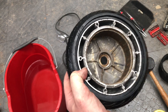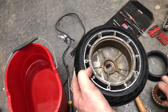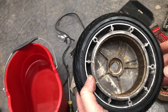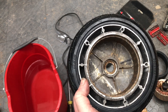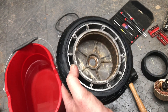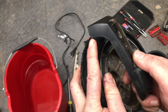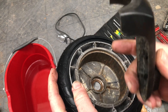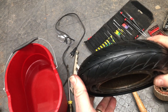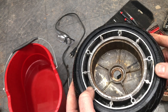All we have to do now is reassemble everything. Obviously the bearing is missing here — it's still on the stator on the back. I replaced the bearings earlier. If you have the tire and motor apart, this would be a good time to replace the bearings if you have any problems with them. That's it — just put everything back the way we found it. When this goes back on, make sure the little notch faces the rear — this would be the right-hand side. I'll put the STL file up so you guys can print your own tire jig.